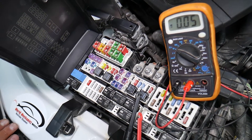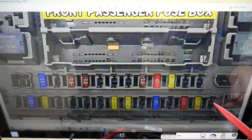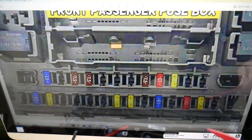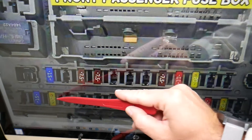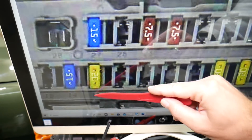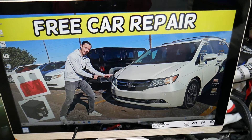So guys, right here, let's explain. We're going to zoom in a little bit. That row of fuses right here — if you start on the very right side towards the very left, you have fuse number 1 through 15, with the fuse numbers listed on the bottom. The fuse that we need to check is fuse number 13. That 20 amp fuse will be the one, guys, that you will need to check. Fuse number 13 — you can see the number underneath it right there. That will be for the rear power sliding door on the passenger side. Hopefully the video will be helpful. Thank you for watching, see you next time.